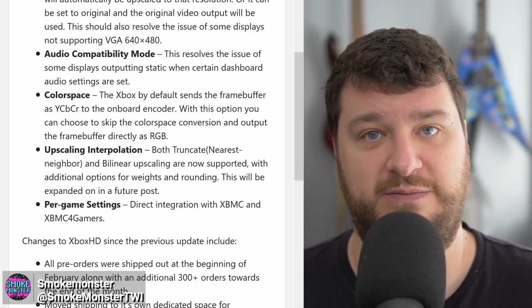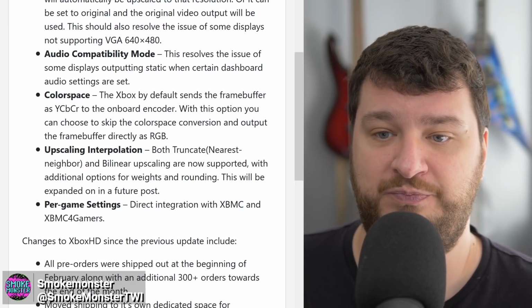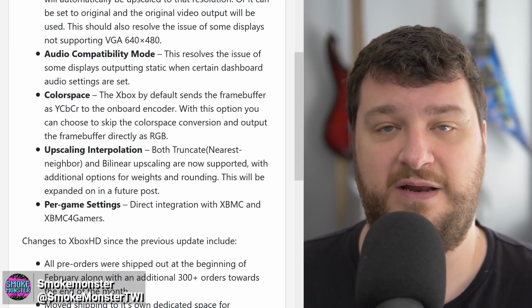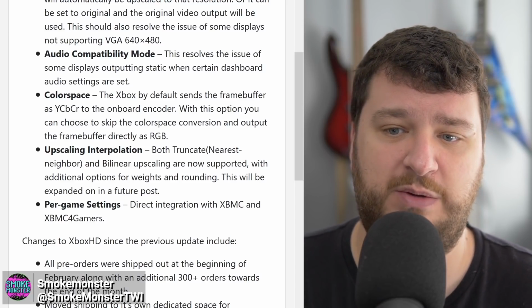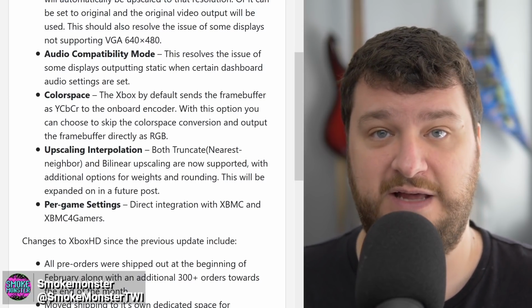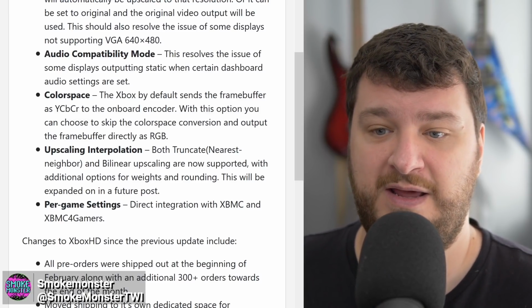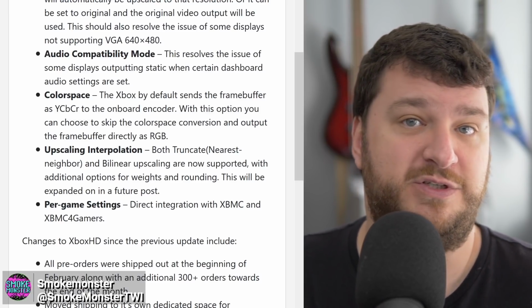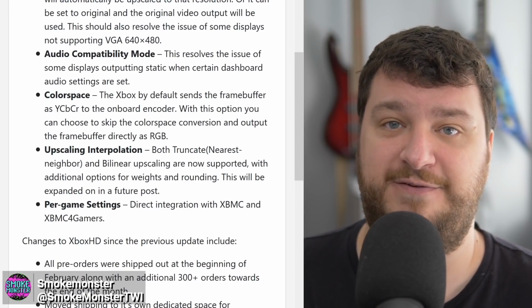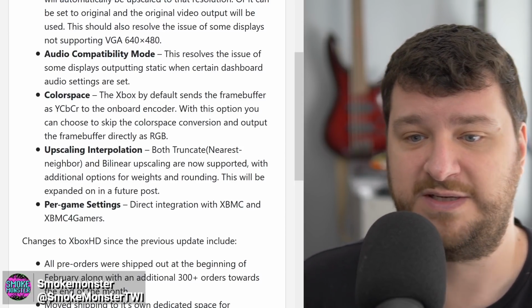And that's a feature that I'm just a huge fan of, that Dan and Christoph really nailed with the PS1 Digital, because as anybody knows, when you're going through this retro stuff, you have a lot of mixed content. In the case of the Xbox, it's probably going to be mostly 3D graphics where you want to soft scale it, the bilinear scaling, but I'm sure there are still scenarios in which you're going to want sharper scaling, or even different resolutions depending on what type of game you're playing. So the ability to save per game is definitely going to be a huge advantage for people that really want to tweak each one, because you only have to do it once.